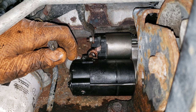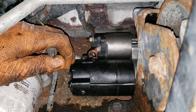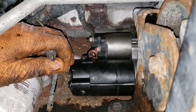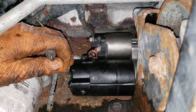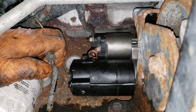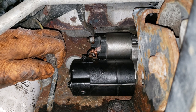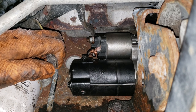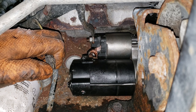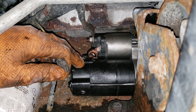With this particular Chrysler, it has an auto-fire feature: when you go to start it, it will continuously cycle the starter until the engine starts to run, for up to 10 or 15 seconds. That makes diagnosis nice — stick your test light or power probe on this solenoid terminal; the power probe is handy because it eliminates guesswork about positive vs. negative side. If you have signal the test light will illuminate and the power probe will make a sound. I've already tested it off camera and that's how I came to the diagnosis that this was the problem.